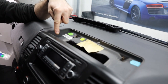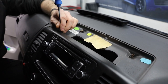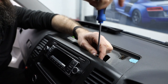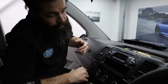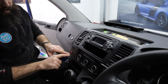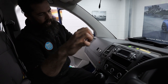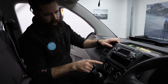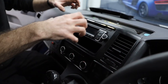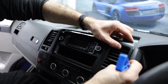On the top of this panel here, we've got two T25 large screws — they've got quite a heavy thread on them. Wind those out and put all your bolts somewhere safe. There are various clips down the sides of this panel and a couple through the middle, and there are locating hooks at the bottom. So we're going to pull the top out, work it out, and then take it off from there. Before we fully remove it, we'll just have to unplug various things. As with everything, don't just go ripping things off — try and get in there and use a bit of tension from a trim tool just to run down and help release those clips.